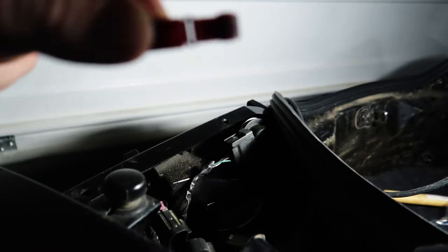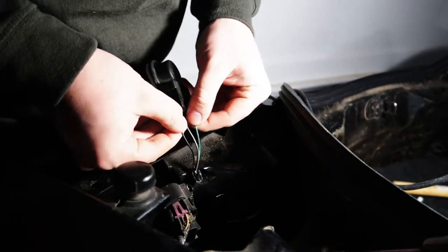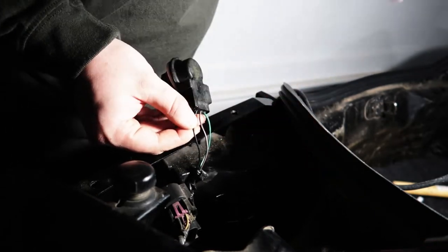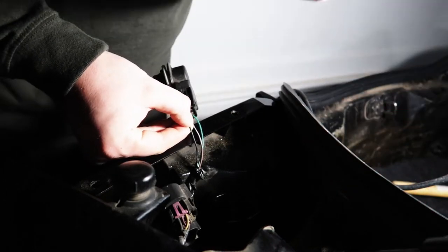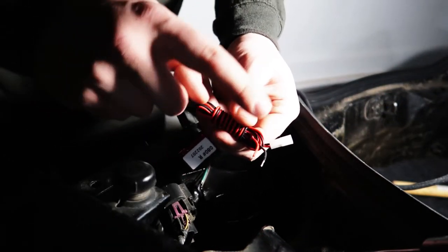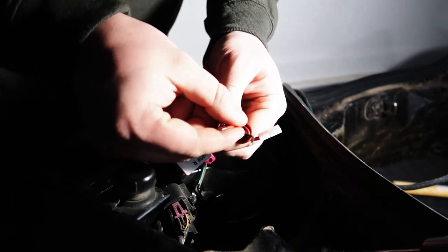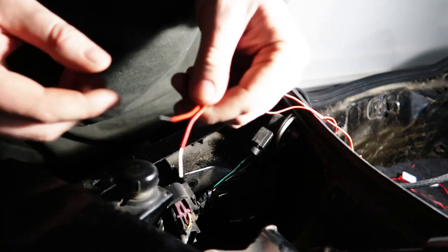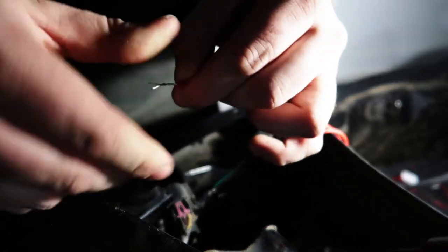As you can see, we have the black and brown wires here — we're attaching the T-taps to those. You get four T-taps total: two on each side of the car, and four connectors for your Oracle lights to work. All you do is match like with like per side — red wire to red wire, black wire to black wire. We'll put on the butt connectors, then do the T-taps and get these lights installed. I stripped the wires a little more to get more twist and bite so we never have to worry.